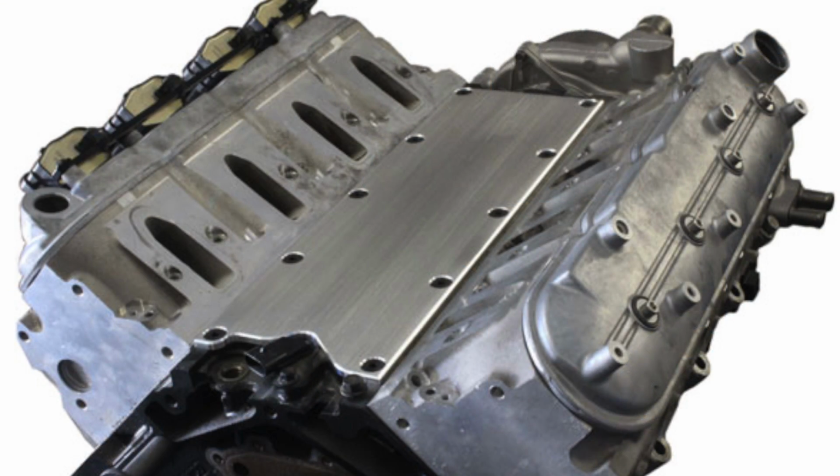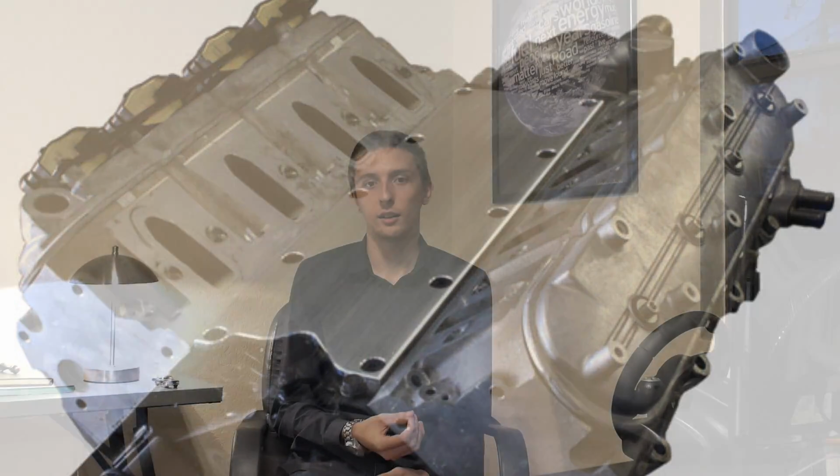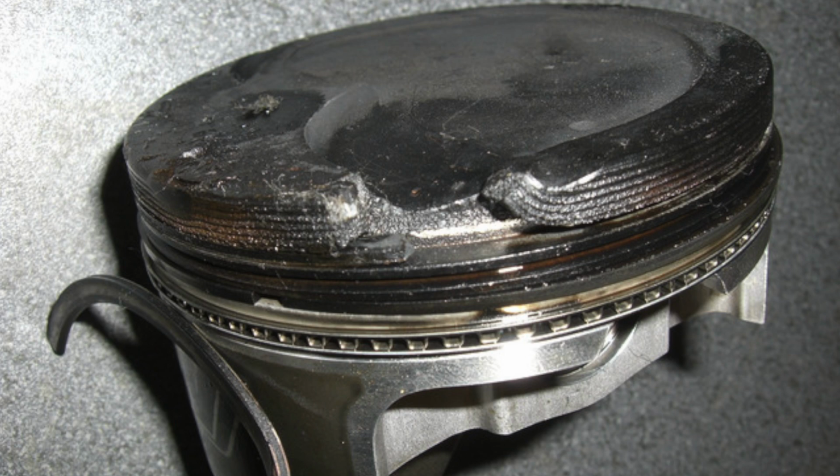To further increase the strength on top of the engine block, they used a valley plate. The valley plate is a large plate of metal that covers the valley where the lifters reside. This increases the strength of the block by bolting each side of itself onto one metal plate. The pistons are the weakest point in the LS engine. They're pretty strong, but once you start getting into serious performance, they are the first component to fail. All of this combined made the LS stronger and smaller than any other GM small block before it.